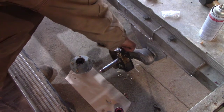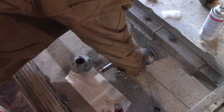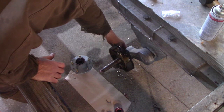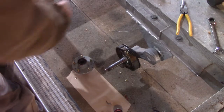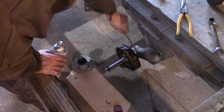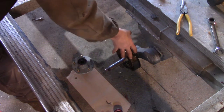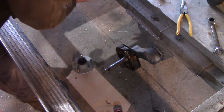Go ahead and secure this down. If you don't have that square flange on the axle, you can't do electric brakes — but most axles come with that square flange. I don't think I've ever seen one without it, though cheaper axles sometimes don't have it. For the most part you're going to have that square flange to put brakes on, even if your trailer didn't come with brakes. This is pretty straightforward — just 16 millimeter bolts. Be mindful of the wires; if you're not working overhead there's a possibility of pinching them on the flange.